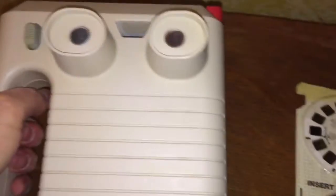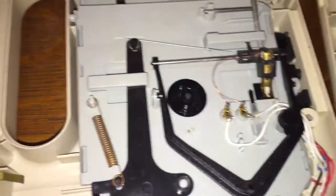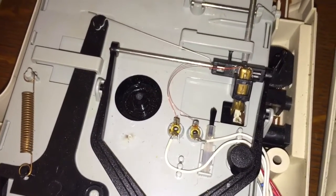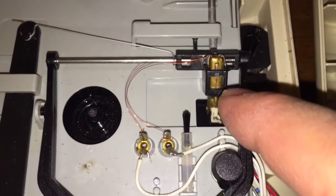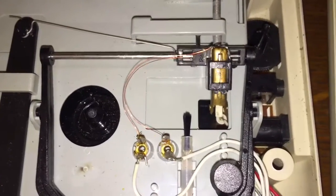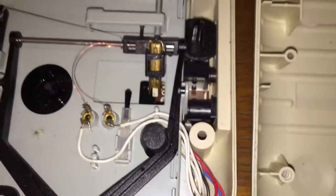I wanted to show you what this thing looks like on the inside, so let's open it up. I've already removed all of the screws before this video started. Inside is an amazing instrument known as a turntable — this little 3D machine has a linear tracking turntable on the inside. Here is your turntable, and this is your ceramic phono cartridge with a stylus. If I push on this little lever, you can see it lift up. The audio comes off of this and goes to a bridge and down two wires to the amplifier underneath.